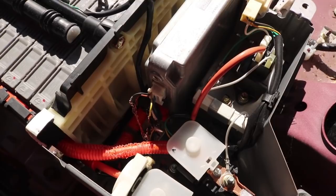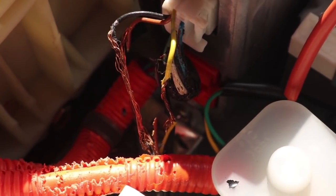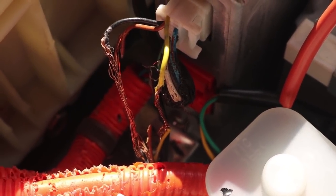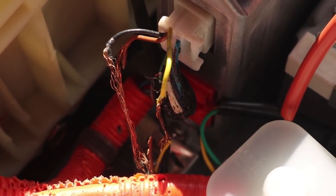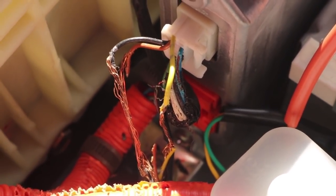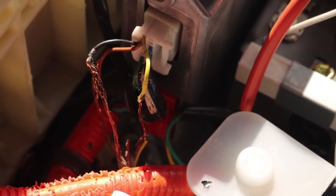Just as a reminder, mice got into the battery and right back in here they literally chewed through a number of wires. For anybody who said just use a little liquid electrical tape or splice them back together - not so easy. I pulled all the wires clear of each other so they wouldn't short or anything. Tried testing the car again - no good. And also they're very, very short wires. The whole thing is only a couple of inches long between the battery ECU and the actual current sensor, and there's just not enough there even to splice really.